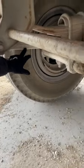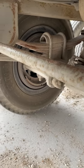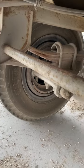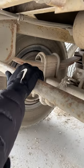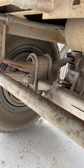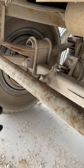I have my torsion bars. Make sure my torsion bars are not bent, broken, or cracked, properly mounted, and secured. I have front and rear spring mounts — make sure that they're not bent, broken, or cracked, properly mounted, and secured. I have leaf springs; make sure that they're not scissoring, not bent, broken, or cracked, properly mounted, and secured. My U-bolts are not bent, broken, or cracked, properly mounted, and secured. We don't have airbags or shock absorbers, so that does it for suspension.